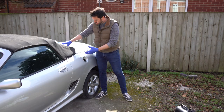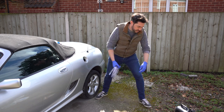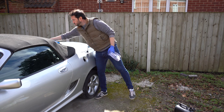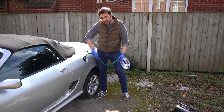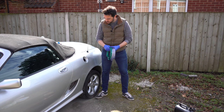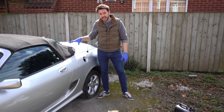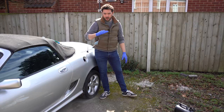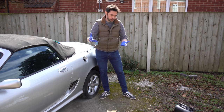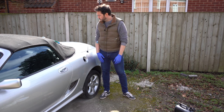The plan is to get this flexible hose, stick it in there all the way down to the bottom of the fuel tank, put the other end in a suitable container, then put in another hose just into the filler neck, block it up, and blow into it - that should force fuel out and create a siphon. I think it's a 50-litre tank on these and the needle's just below halfway, so I've got around about 20 litres in there. I've got enough containers but I'm going to have to take this to the recycling centre bit by bit.